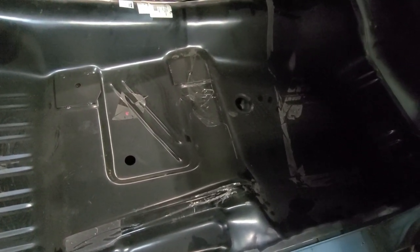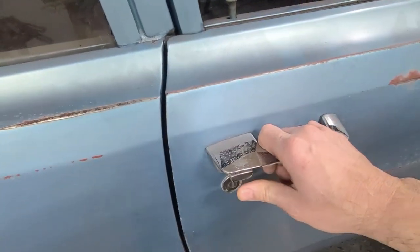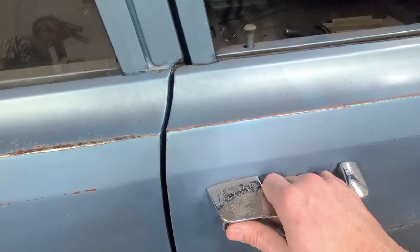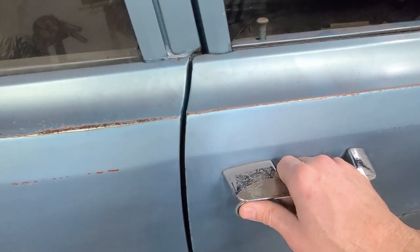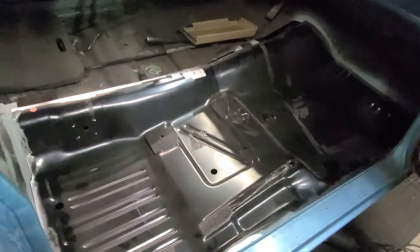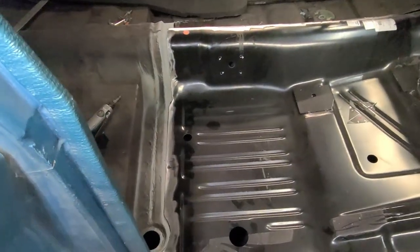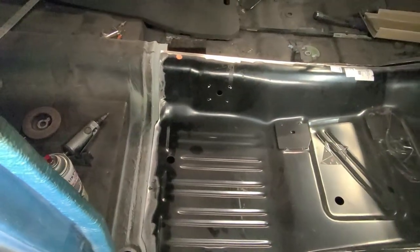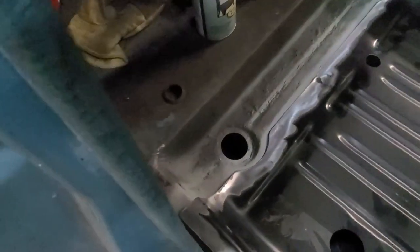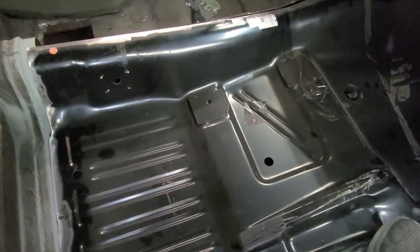This is the first time I've tackled anything to this level and I've been having a little bit of anxiety — even just removing the floor pan I was like, is this going to mess up the structure? Are the doors going to shut? But it did not weaken the structure at all. The doors are still open and shut just fine, the gaps haven't changed. Plus, these floor pans were so rusted in the back that I don't really think they were adding much structural support to the car anyway.